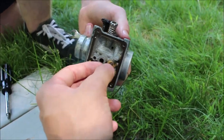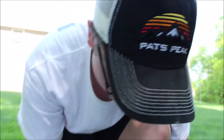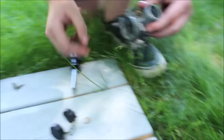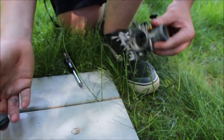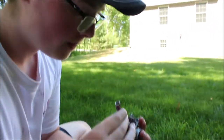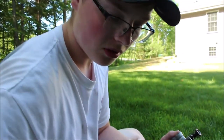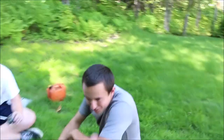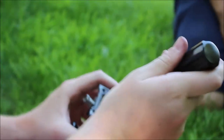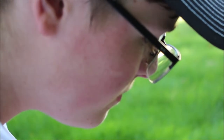This could be set too low or too high with the float and it's not doing the right thing. Do you see how it pushes it up and down in there? John's blowing into the carb because some of these you can't really see. It's blowing right through them, so everything's pretty clean. We're taking out the last jet now, just making sure it's all clear. John clearly has a tendency to under-screw these. All the jets are clean.